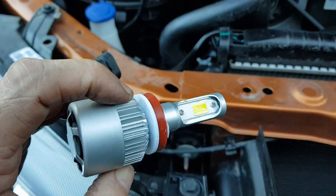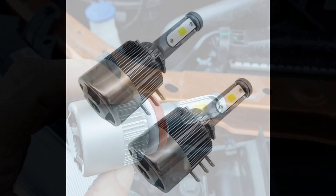They're just probably one of the worst headlights I've seen, and for a car like this it's not acceptable. This is one of the H11 LED headlight bulbs that I put into the dip beam - I'll put the link below if you're watching on YouTube - but it made such a difference to driving at night. So I tried looking for an H15 that was similar that I could put into the main beam, but unfortunately everything I came across, there was absolutely no way it was going to fit.